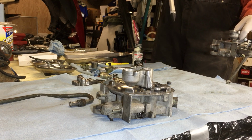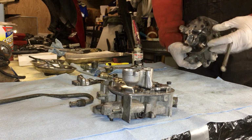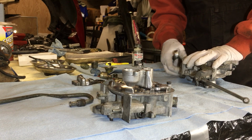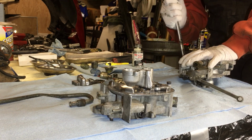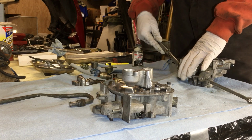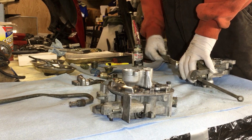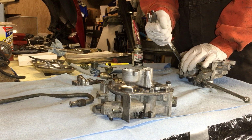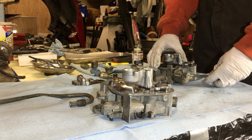Just gonna kind of... alright. So 17 foot-pounds, I probably should get the torque wrench out. That'd be actually kind of fun, but pretty sure I'm driving it to 17 because 25 foot-pounds is usually like an oil drain plug, 20 to 25. Yeah, I could easily over tighten this. So we're good there. A lot of times you can feel it. You just kind of, just gonna feel it. Kind of a car whisperer sort of thing, you know.